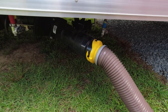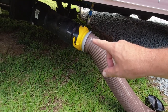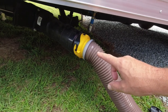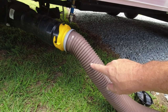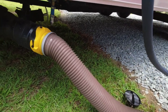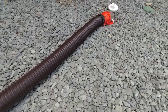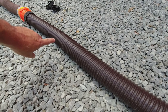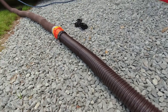While the black tank's dumping — a few things: they make a 45-degree clear fitting that goes here. I've always meant to buy one, I never have, but I think eventually I will get one. When you buy a kit, depending on which kit you buy, normally you're going to get one of these cheaper hoses. These hoses are okay and they'll last a little while, but we've had several get pinholes in them and that is definitely something you do not want. This heavier hose here — I'll look up the name and post it below — seems to work a lot better for us. I'll post the link below. I'm sure there are nicer hoses but we've just had good luck with these, so we stick with them. I just need to buy another extension.